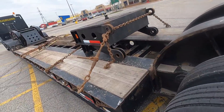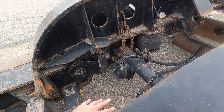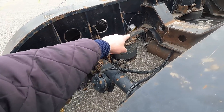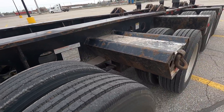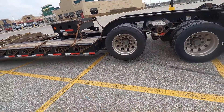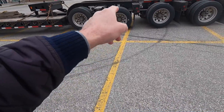I spent half an hour doing calisthenics with these timbers — putting them on the tires, dropping the suspension, then hooking the chains. I don't have airlift, I have chain lift, so I need to drop the suspension, put the tires on a couple of boards, tighten the chains, and close that yellow handle so air goes into the airbags, then reinflate. Running like this empty should give me probably almost half a mile per gallon extra, only running on axle 2 and axle 4.